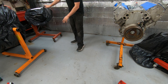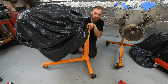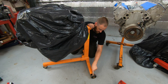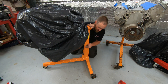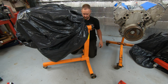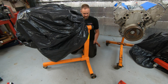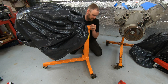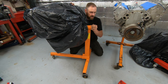This one here just doesn't have a huge support load capability. I currently have way too heavy of an engine on it for the size of this unit. This one's got straight wheels with an axle welded on it — I'm not a big fan of this one either. I acquired it for next to nothing as a backup engine stand, and after having the issue I did, I'm probably going to try and avoid using it. I can imagine if I tried to rotate it and hit something, it could easily tip over.